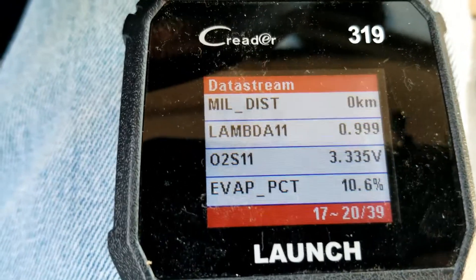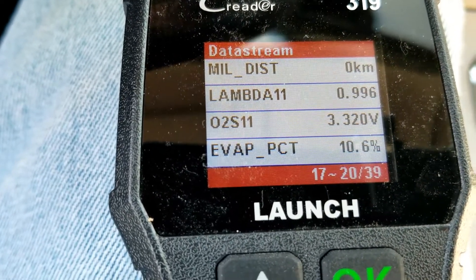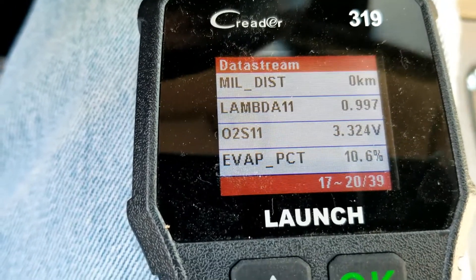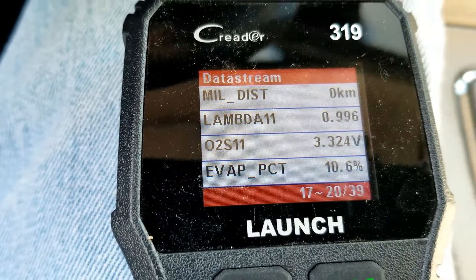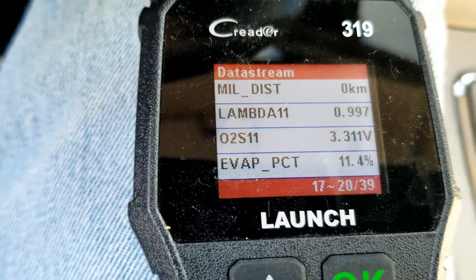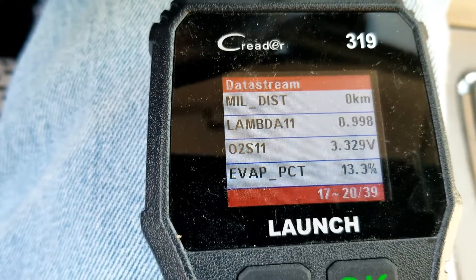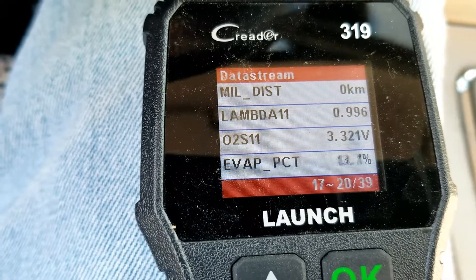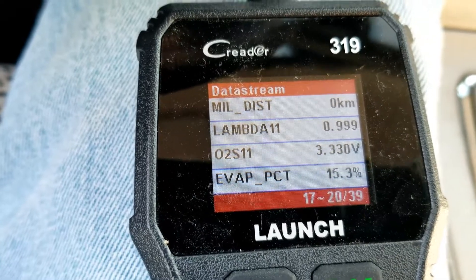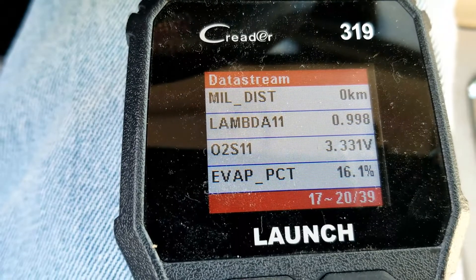The sensor seems to be doing what it's supposed to do. There are some more tests you could do on these, but this is a very basic test to show you that if the sensor is working correctly, when it goes into a lean or rich condition, this voltage should change, and when the condition is gone it should return to its default idle state. These sensors also have a heater element side — I'll put a link in the description below for how to test that. If you have anything to add, please comment below. If you have questions, ask me. If this video helps you, please click like, subscribe, and have a good day.